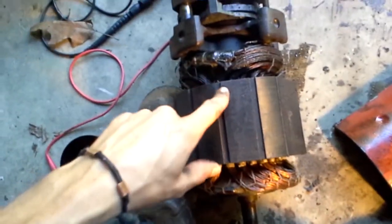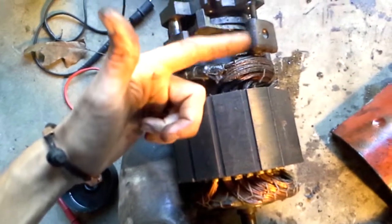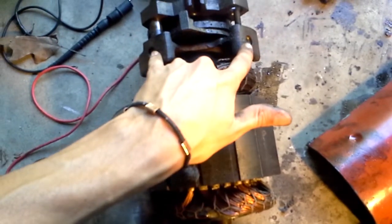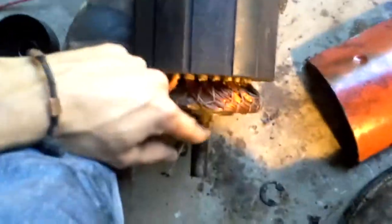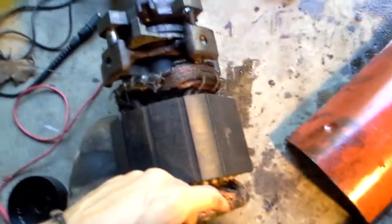This is one of the sides of the case — you can see the little dimples here on the outside. What those do is lock the compression assembly in place to keep it from spinning as it runs. This is an oscillating scroll — it doesn't go in and out like a piston, it oscillates back and forth. Without something to keep it in place this whole assembly would free-spin any time the rotor spins.